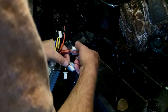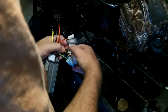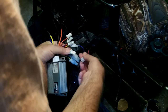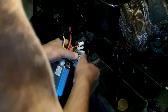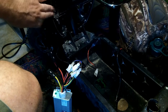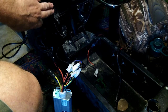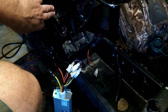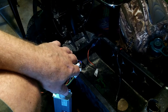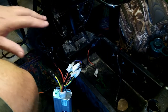This one says brake lights — I don't have a brake light — and here's another that says brake. They're both yellow-black so I'm just going to plug one brake into that. You may not use all the plugs. This is an Uber Scoot 36 volt 1000 watt — it doesn't look like the one online because I did a custom camo paint job, but all the frame components are correct.